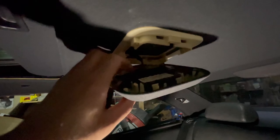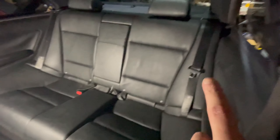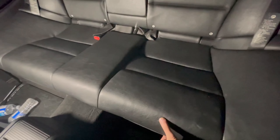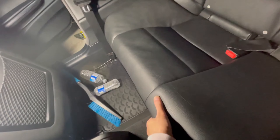Disconnect the cable right there. Now we have to go to the back of the car. Pull up the rear seats and remove the shoulders. The rear seat should be pretty easy — just pull up at it and it just pops out.